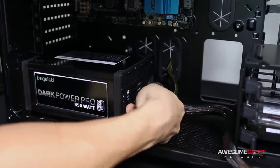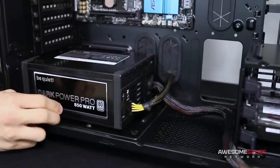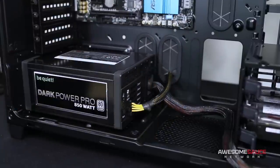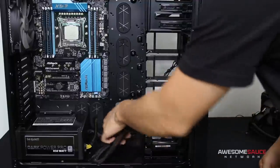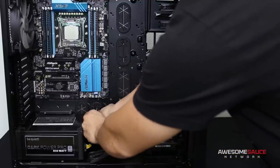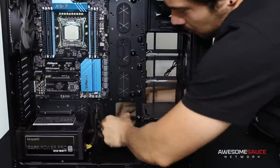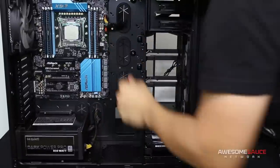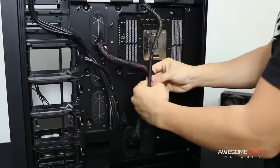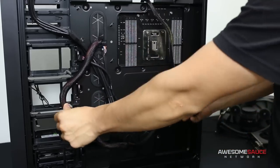You'll want to leave a little bit of slack, making sure not to pull the cable so tight that it puts strain on the power supply or the motherboard connectors — and this rule applies to all cabling in your system. Next, move on to your 24-pin ATX motherboard cable. Connect it to the power supply if it isn't already attached and route it through the same grommet you used for the 8-pin cable, then run it out of the hole nearest to the motherboard connector. Since these are the thickest cables in your system, keep them from overlapping each other, keeping things as flat as possible.